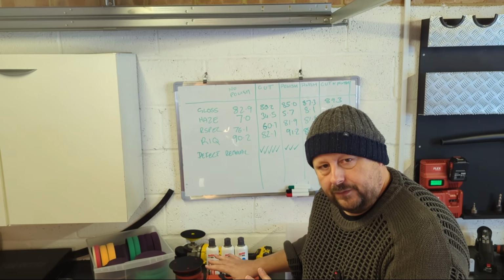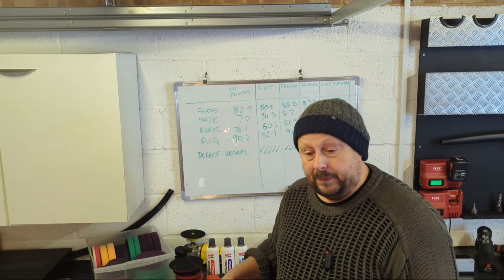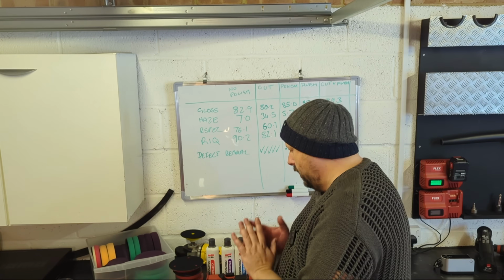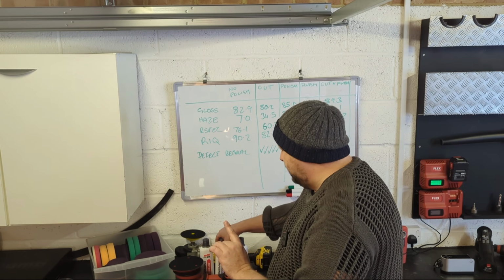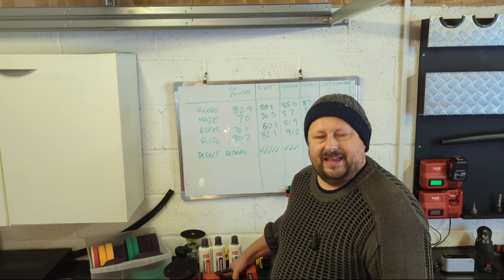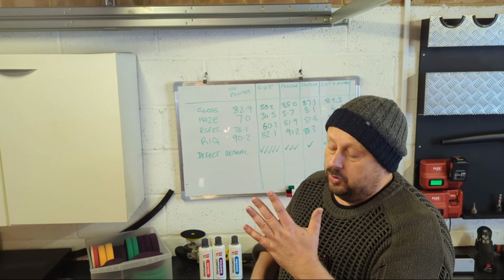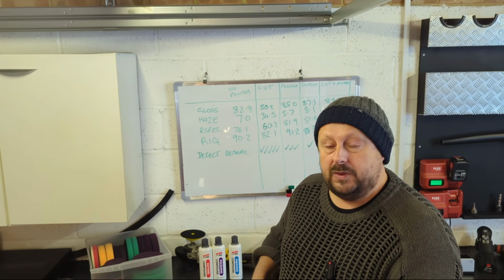So that's your 3 different types of machine polishers, guys, and most people will be using free spinning dual action polishers. Okay, how do you go about using them? Well, let's start with a cutting set, for example. First of all, you put your cutting pad onto the machine. Your pad will be bone dry with no product.